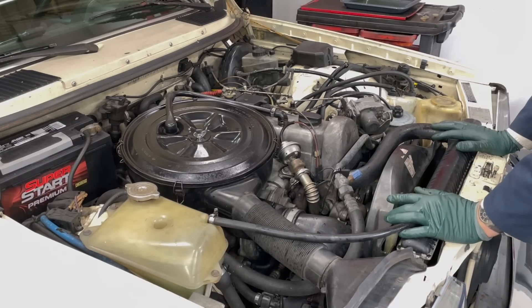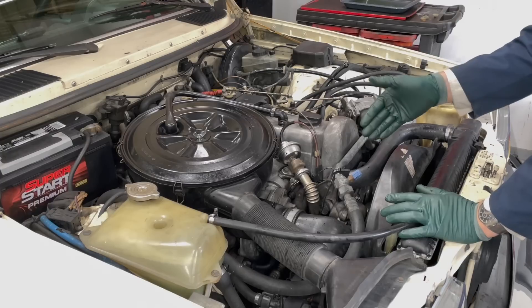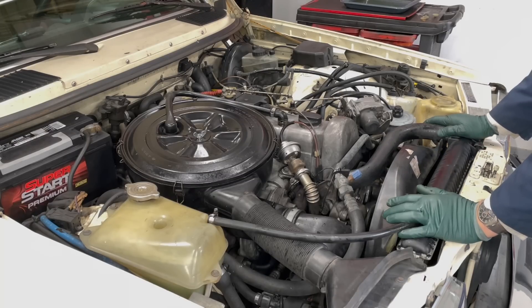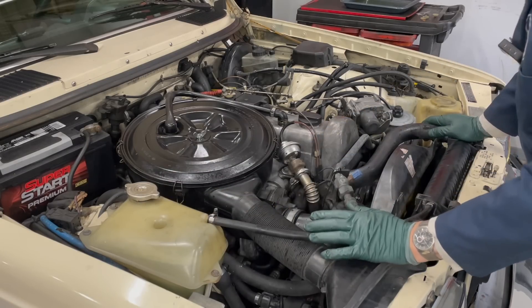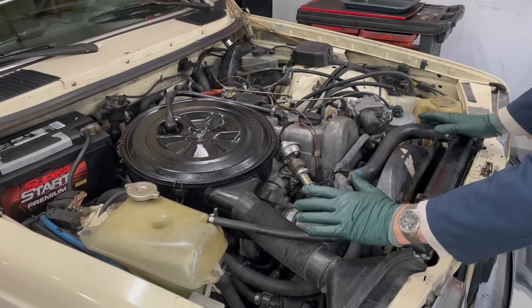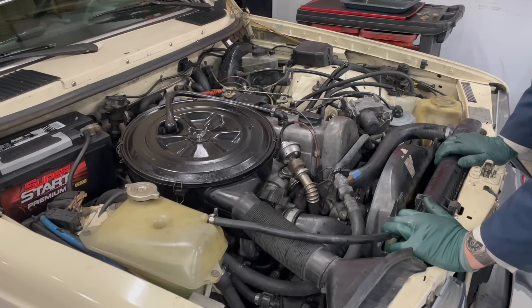Let's take a minute and talk about chasing coolant leaks. I'm sure some of you viewers have been there where you thought you knew where the leak was. Let's say you changed the water pump — you were sure the leak was coming from the water pump, you changed it, still leaking. Find out it's some little hose or connection that only leaks at high pressure while you're driving down the freeway. There's a better way than using your eyeballs. I developed a special cap that will attach right here so I can do a pressure test — I'm going to actually pressurize the cooling system. I should be able to see where the leak is because that pressure is going to try to come out where the coolant has been leaking.